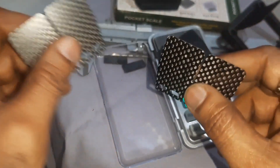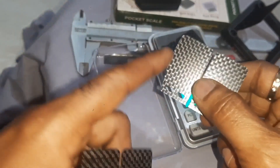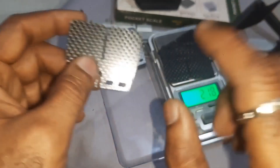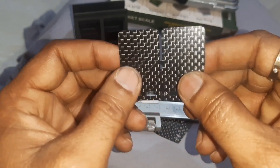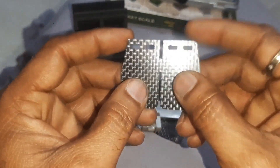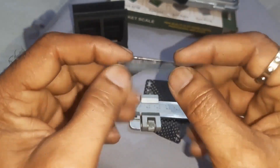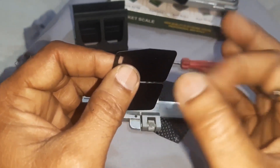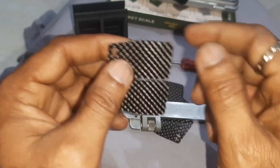The thickness of the reed petals is very, very important. The material — including the shape of the reed petals — is very important for the performance of your vehicle. This is carbon fiber. When you hit it, the sound will come. It is flexible, but do not bend it too much — it will break.